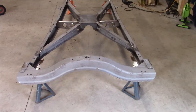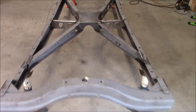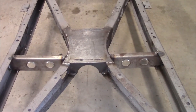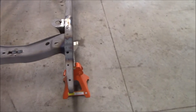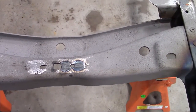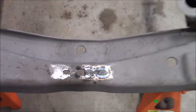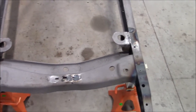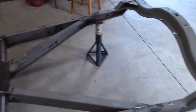Looks like the frame is pretty much done — it's all welded up, finish welded and done. Got the center braces in there and the frame is way stiffer now, a lot heavier but way stiffer. Final welded the motor mounting in there, and I was able to straighten the horns with some heat — they weren't too bad off. I did find some cracks in my front crossmember; I welded those up on both sides, ground them down with pretty good penetration. The frame is done, I think, so far — there's always something else.